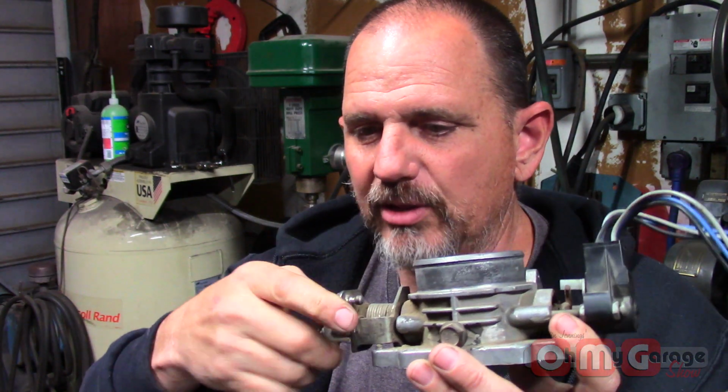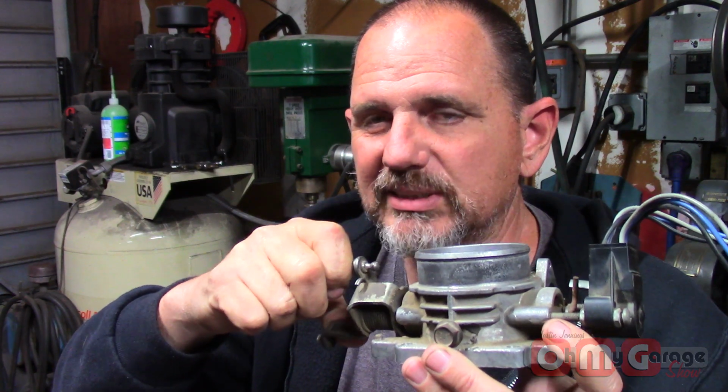But what I figured out, I took some measurements on this. This is just a potentiometer, and in this case there are 2 in here. They start at a certain resistance and go to another resistance. The best I can remember, when you give it more throttle, on the side that goes to the computer the resistance goes down, which means the more open it is, the more voltage goes to the computer, so it gets a higher reading. The one that goes to the transmission starts low and the resistance goes high, which means the voltage goes down with more throttle. So running it the way we had it, there is a sweet spot somewhere when it's about fully open where it says, oh, I can shift into overdrive.